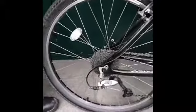The only thing with trying to reset your derailleur like this is it is a case of trial and error, so you'll shift wee bits and then check it and go back and adjust it. That's why, when doing it as a job, having a stand is much more beneficial. But it's a time-consuming job, yeah. It can be. So let's check this and see how it's going now.